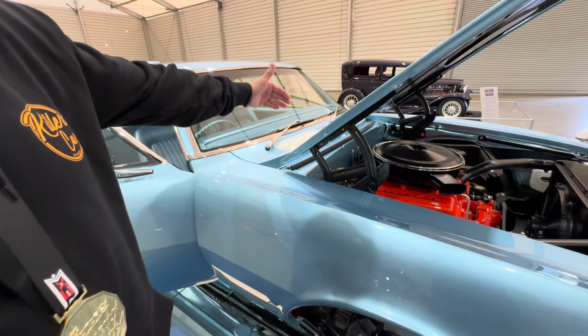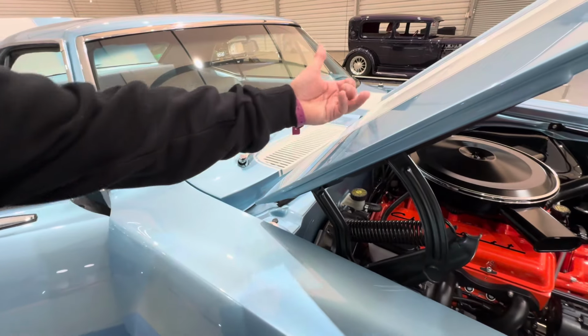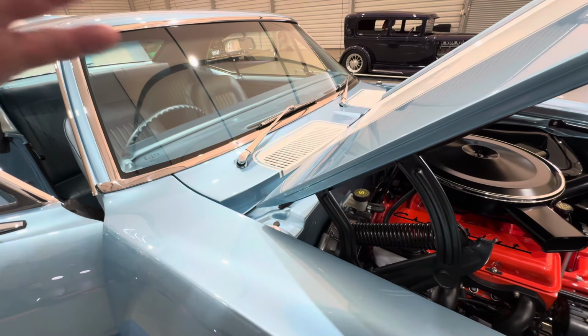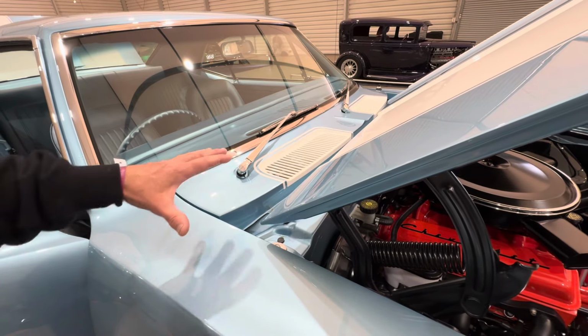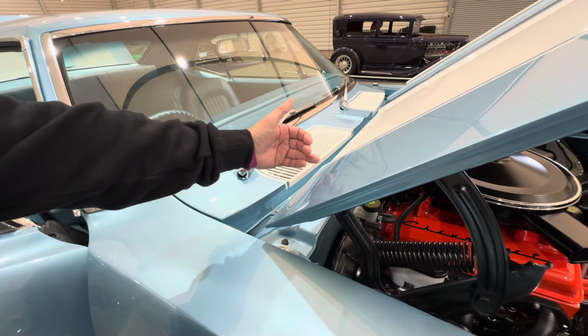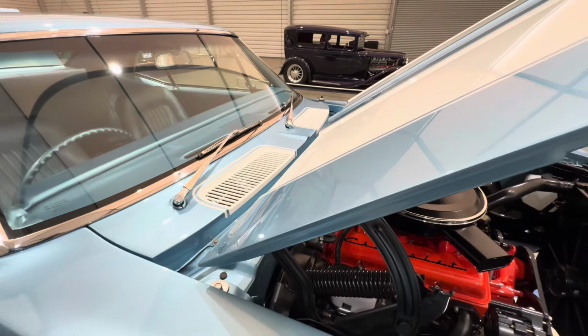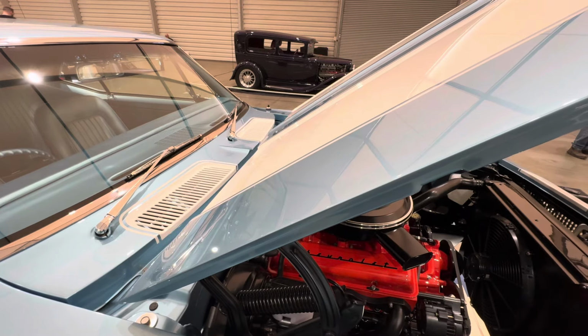Especially after we did the ivory stripes, there's a lot of build up for the clear because these are dead flat. There's no edging on anything, so you've got to block everything properly. So when do you put those on, after or before? When the vehicle was all blue, then we mask up and do the ivory stripes. Then there's clear coating right over the whole top of all that. So you don't get any edge on there? Yeah, there's no edge on there.